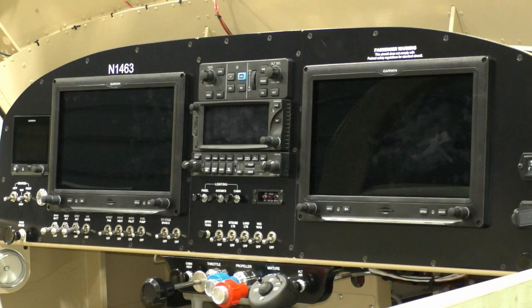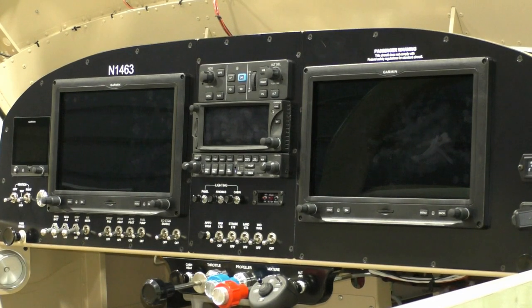This RV-14 has a pretty good avionics package. It's rated for full instrument flight, with two 10-inch touch displays showing all flight data, maps, and charts. It also has navigational data, GPS, autopilot, communication systems with two radios — communication and navigation type — and a backup display for heading. You'll see the controls for the throttle, propeller, and mixture low on the bottom, and the circuit breakers further down.